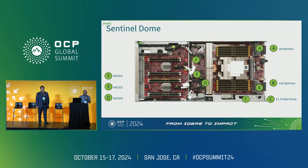F shows another MCIO connector and cable providing another eight lanes of PCIe Gen 5, going to another onboard e1.s SSD or data drive indicated by H. G shows a multitrack connection capable of providing both power and another eight lanes of PCIe Gen 5, going to another expansion board called Floating Falls. Floating Falls consists of one CXL ASIC and its own set of four DIMMs — essentially half the capacity of Wildwood Falls. And I is a boot drive for the SentinelDome, connected through a cable and a 1C connection, with another four lanes of PCIe Gen 5 traveling through it.